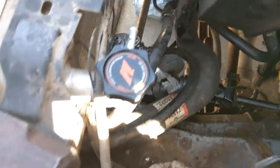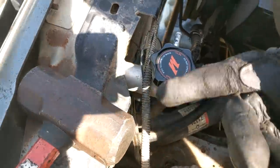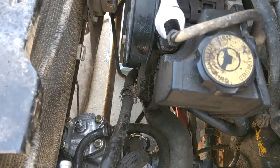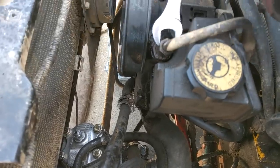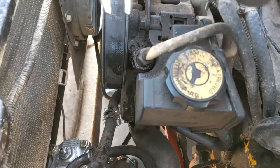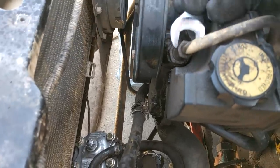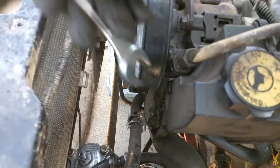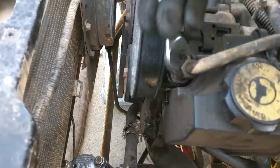It's a 5/8, and with a little WD and a tap of the sledge it broke free. I replaced this a couple years ago when I put the new pump in, so glad to see something works. You can bet I'm going to make sure there's plenty of anti-seize on these in case they ever have to come out again — I'd rather not have to replace them. Just a tip: the other one's really easy, just a little hose clamp and you can pop that right off.